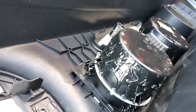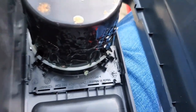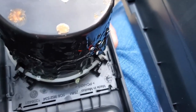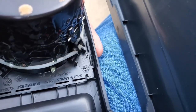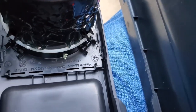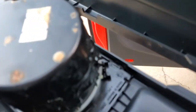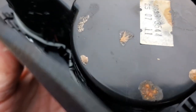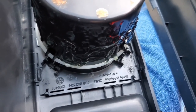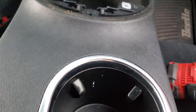I put epoxy over the whole thing — it runs down over the rubber band, no big deal. The four retaining clips steady a smaller cup inside; the rubber band runs around to make these appear spring-loaded. If these quit springing, your rubber band has broke. The thing you have to watch is you've got to make sure that these retainers and each cup holder after the epoxy is drying are free. Looking at it from the inside it looks stock — can't tell I did anything to it. That's exactly how we want it.